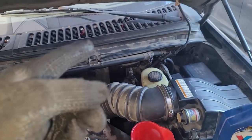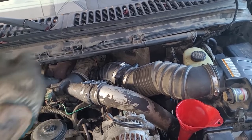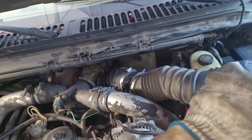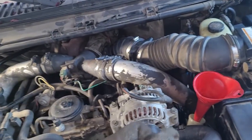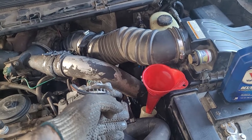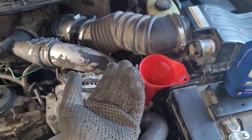Then start the truck and you'll need to bleed the system. To bleed it, turn the wheel all the way to full lock one way, add more fluid, then go the other way and pump the brakes. Basically, once it stops taking fluid you'll be able to see air bubbles coming up — you'll also be able to feel and hear that happening.